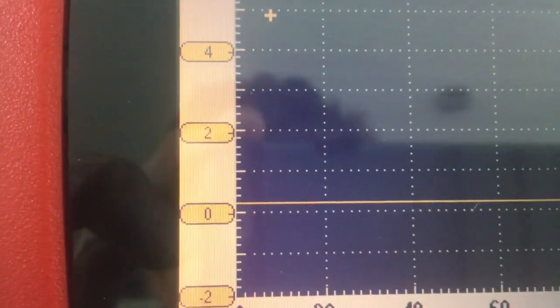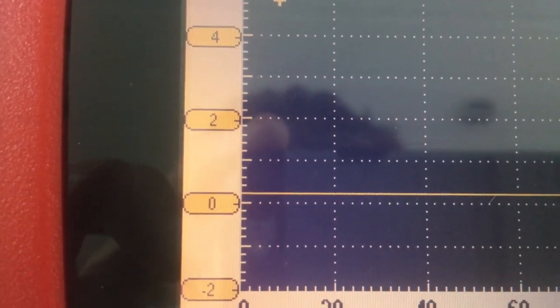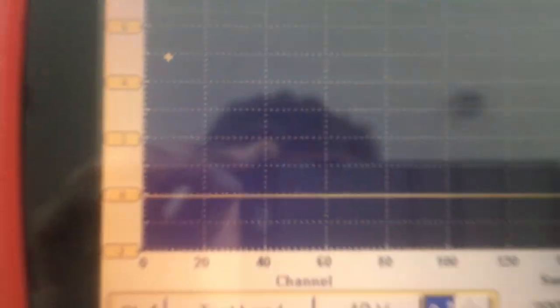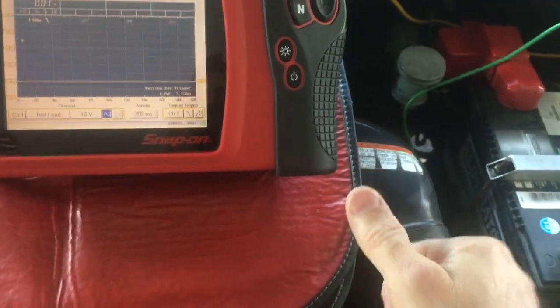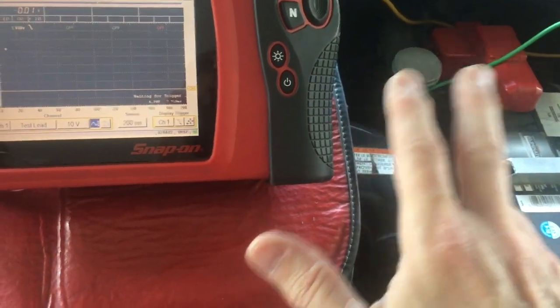There's the ignition off — I think there's a five-to-ten second cutout. You can certainly hear the traffic going by. I can hear the throttle actuator still running, and then it just cuts out and you can see it drop to zero. So again, this is a hall effect type sensor: there's a 12-volt supply, a five-volt reference that's pulled to ground, and there is a ground.